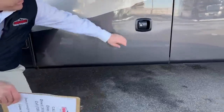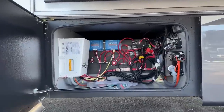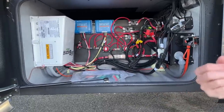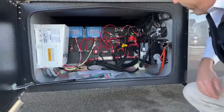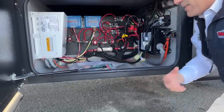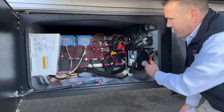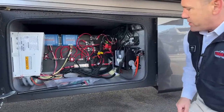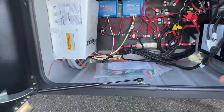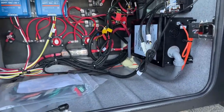This is a really deep slide, but I have it out. You've got your inverter right here. This has also got 800 watts of solar on the roof. With that, you've got two solar charge controllers here and your battery shutoffs. This is a lithium unit, but it also has a generator — it's a really neat all-season coach. Here's your surge protector power switch, but everything's laid out real nice. You do have rotocast bays in here, so there are one-piece bays — you're not going to have any leaks in there.